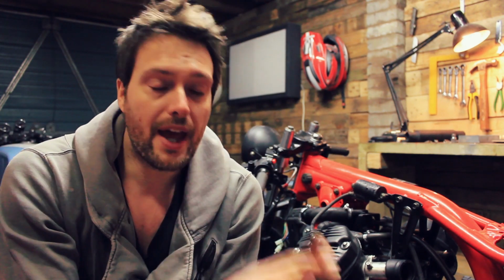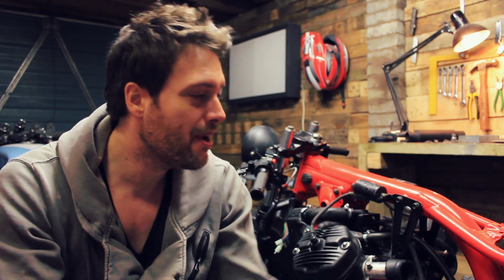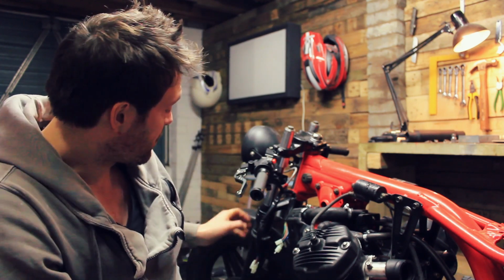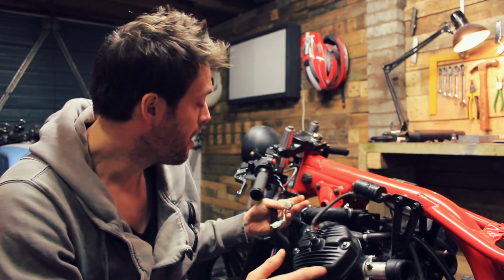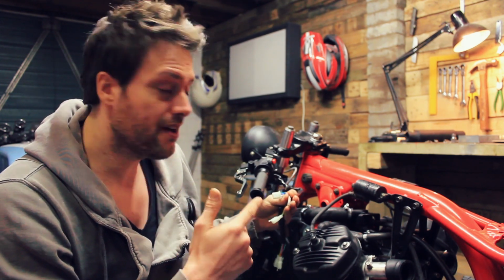So today, like I've said, I'm breaking the CX wiring into 3 different parts. Today is identifying the wires. It kind of uses your common sense if you've got a wiring diagram. The little wires that come off your regulator, your ignition coils, everything like that, are color coded, so you can go through your wiring diagram. But the more confusing things are these, which are off aftermarket controls and obviously don't plug and play straight into your current system. We've got to identify what wires these are and then label them.